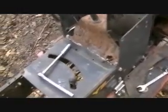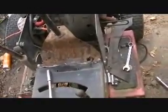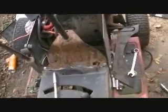I'm just trying to get it to a state that I can get the rear end back in, but I do want to get the brakes hooked up whenever I get the rear end done. So I'm just cooking along at it. It's getting there. It is starting to get there. Putting this panel in here is a bit of progress. I'm happy I got this in because my frame rails are actually starting to bend out a bit. So I'm going to have to possibly put the middle support back in right here.